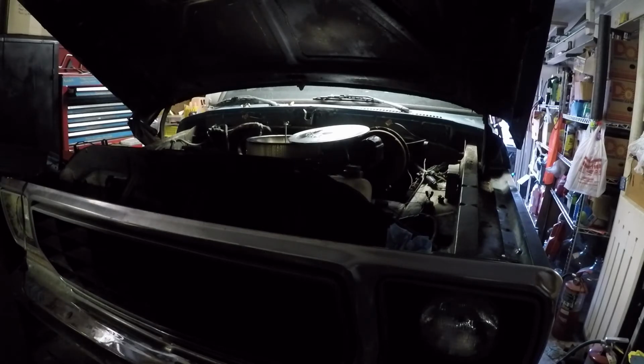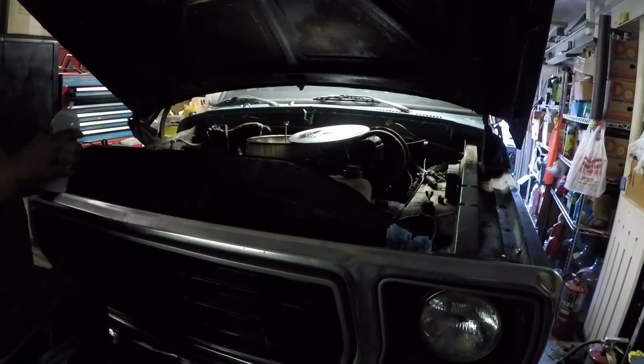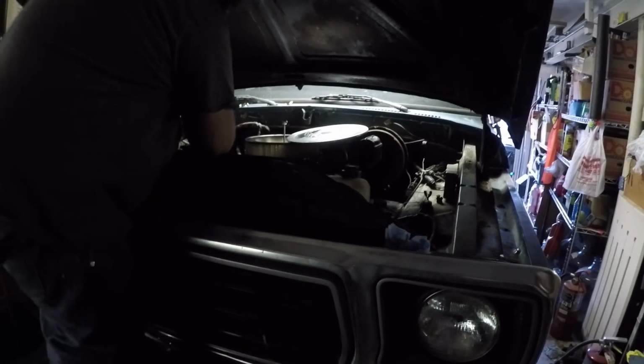I didn't start it while I cranked it over, and the battery's so shot, which is sad. Anyway, it cranked one bark and that was it. I'm giving her some Cosby sauce, some ether, to assist with the lack of battery power. And who knows if there's fuel in the bowl. I threw a little bit of gasoline down the throttle.